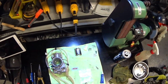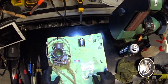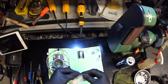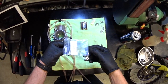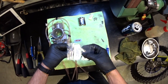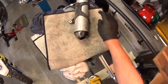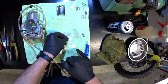I did a little bit of looking around, and a lot of people have been saying there are some inherent problems with this carburetor. One of them being this gasket — apparently it gets deformed inside the stock carb and causes it to run rich. I did take out the spark plug just to check, and lo and behold it was definitely rich — it was wet and black. I also had a lot of spooge all over the back of the pipe. It was way worse before, but apparently this little guy right there is the culprit.